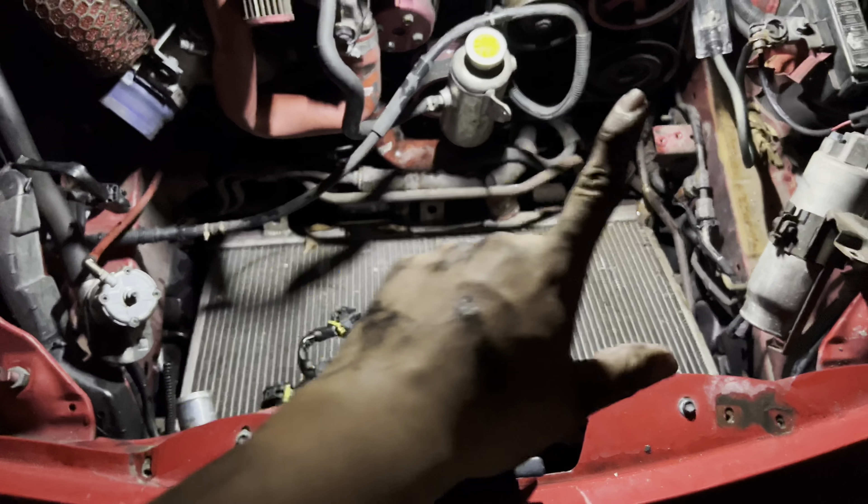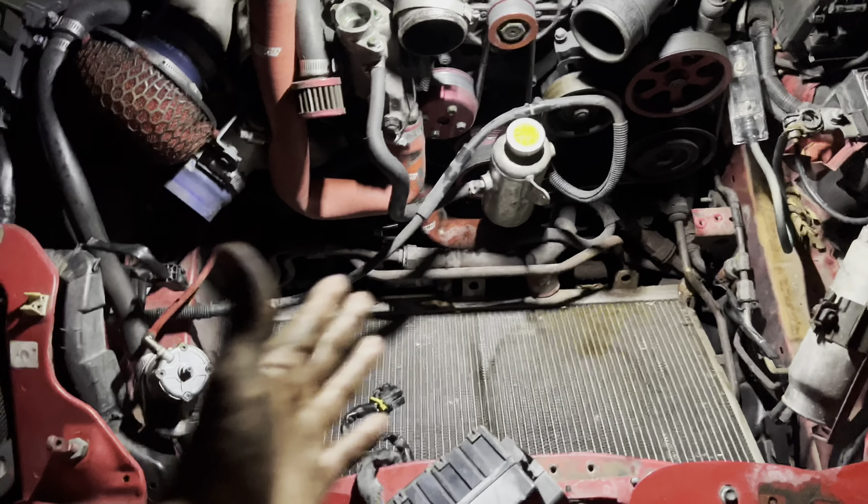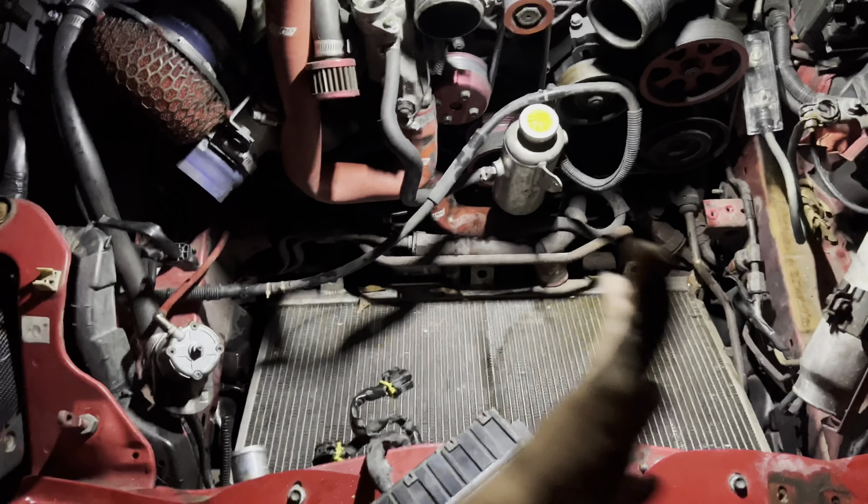I might have to get new hoses — that's a must. I believe I might just put it back on today, so now I know how big of an intercooler I need. I might do a front V-mount. I'm putting RX8 motors and fans in, so I might have to relocate the battery — there's better space for it. These twin turbos are gone, the air pump needs to go, this tube needs to go. I have a general idea now after taking the cooling fans off of what to do.